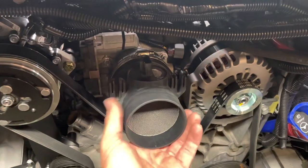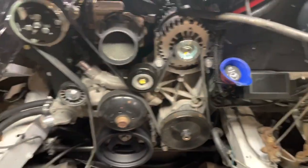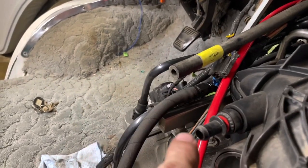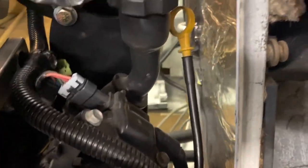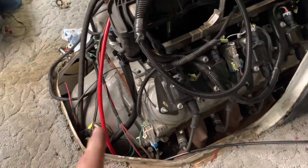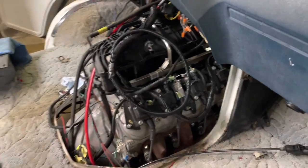At least for the sake of starting it, it'll have everything it needs. I'm going to put the clamp on where it needs to be — don't want that to fall off. I put gas in it. Battery is in it. Like you already know, we saw it spin yesterday. All I have left to start it, other than putting this feller on there, is I've got to connect the MAF connector and loop a section of hose so we don't have a huge vacuum leak. I put the dipstick tube in — it popped right in there super easy. That's stock for a 2011 Silverado. I've checked my fluids and put power steering fluid in it. I'm going to put this in and we'll see if this sucker will start.